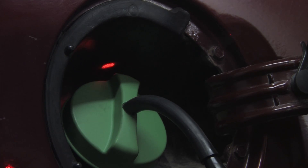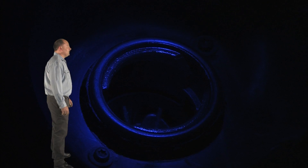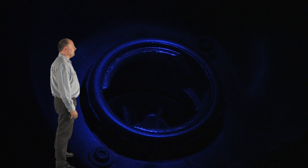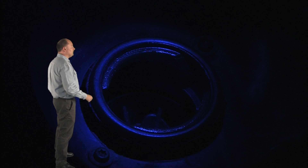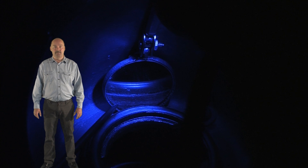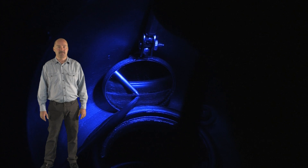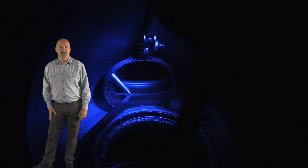Using a laser, it's obvious we have a leak around the cap area. Remember, this cap has been replaced. Using the black light and looking closely at the sealing point of the cap, you can see the dye is only on the inside of the sealing area — meaning the cap is doing its job. This filler neck uses a plastic cap locking mechanism inserted into the metal pipe, and the cap seals to this plastic insert. Looking very closely, it is clear the leak is coming from between the plastic insert and the metal pipe.